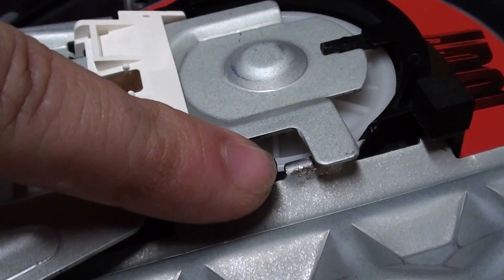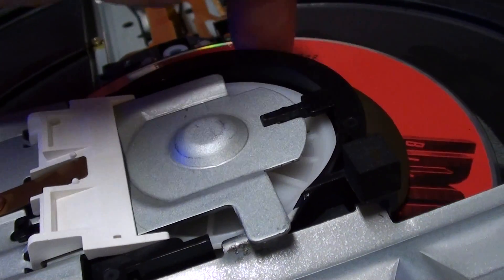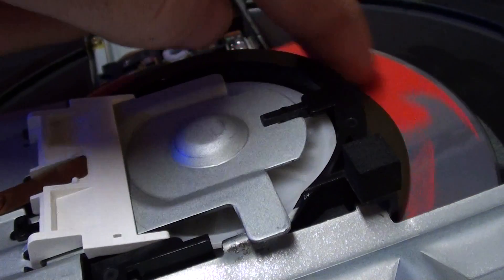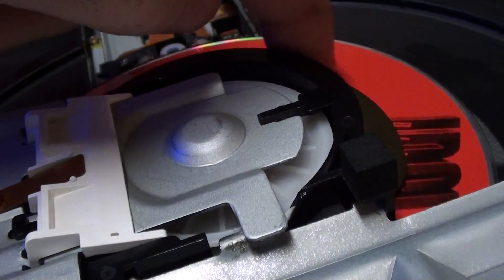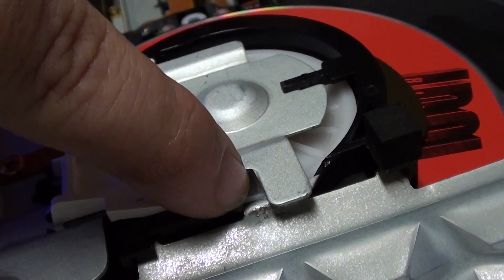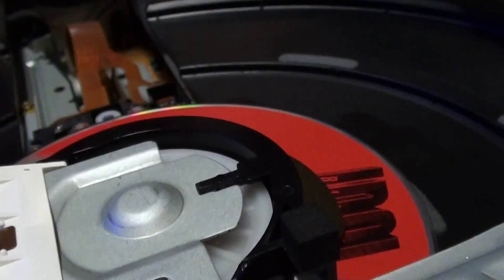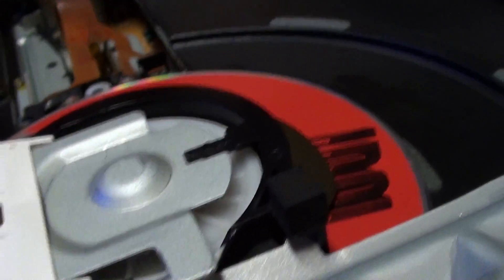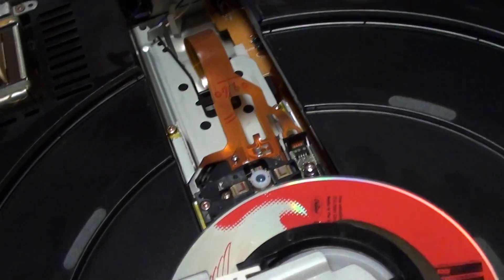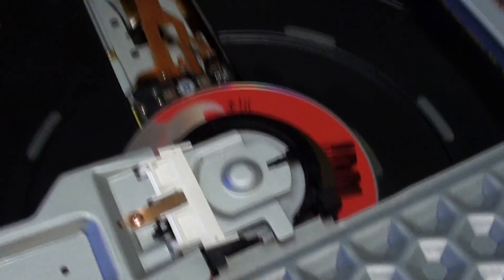I ended up taking this center piece and bending it back just so I could get the spindle loose. You can see how loose it is right now. When I tried it before, this thing wouldn't even turn at all, because this plastic right here was hitting it for some odd reason. Maybe this thing got bent somehow. It definitely would not allow the disc to spin. The laser itself, as you can see right here, moves back and forth perfectly — the laser seems to work just fine. Just the disc wouldn't spin.